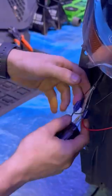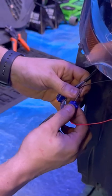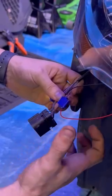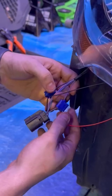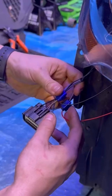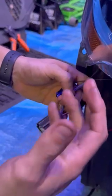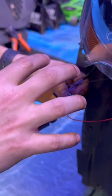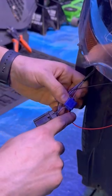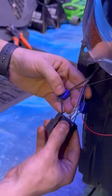We've got the neutral here. Our red hot wire is going to plug into this purple and gray wire on this harness — same thing, just crimping them together. This is what's going to get you power to the actual headlights. This is your DRL wire, so every time this car turns on and the DRLs are on, those lights on that grill are going to turn on. So this is your DRL, this is your neutral, and that's pretty much it for this harness.